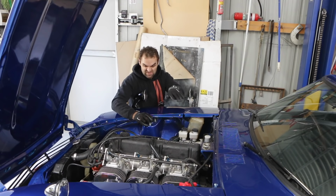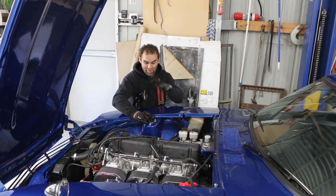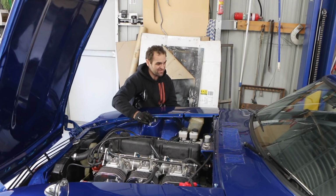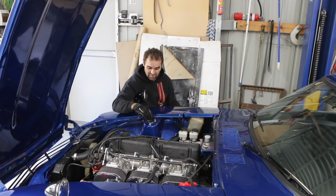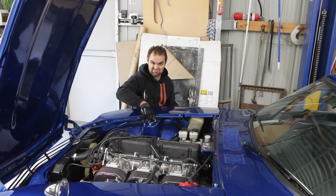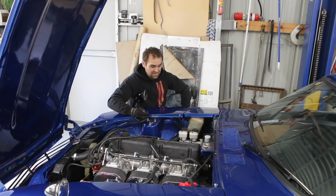While I've got the bonnet open, the next little simple thing I'm going to do is go through and just soften up my dampers all around. The roads around here are really rough, and I've been driving it around, and it's not terrible, but it's rougher than it needs to be. So I'm going to turn these all down to full soft now, and we'll just drive around like that and see how they are. The fronts of these MCA coilovers, they give you a couple little tools for the front ones because the bonnet doesn't close if that's on. So I can just turn around the top, click it down all the way closed. Do the rears. The rears have the fitting right on the top of it, so it's easy to just click it there, and hopefully it should be a little bit smoother to drive.